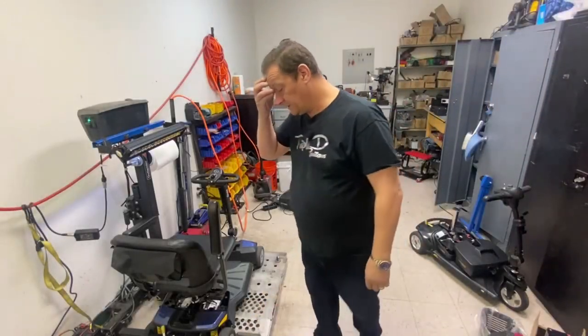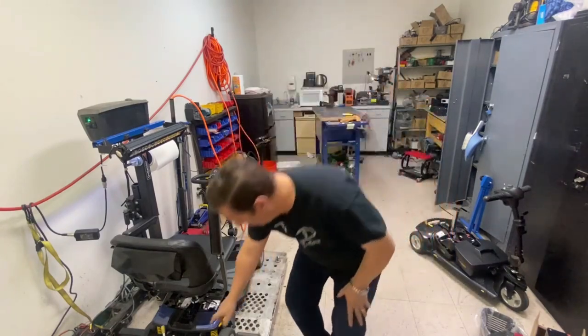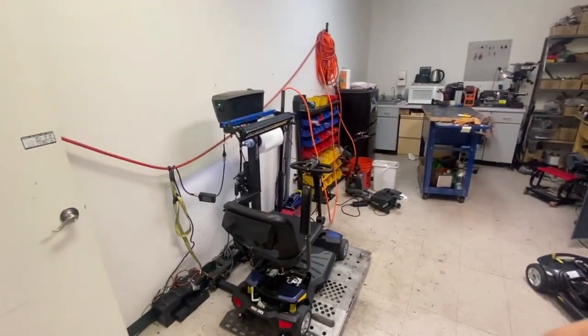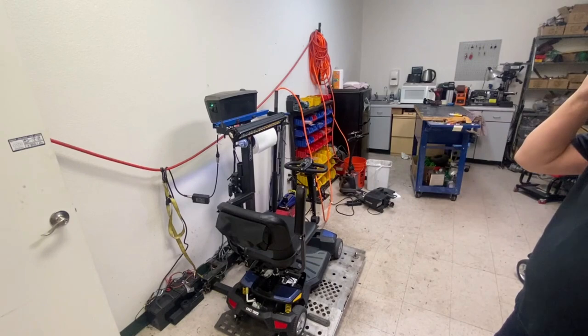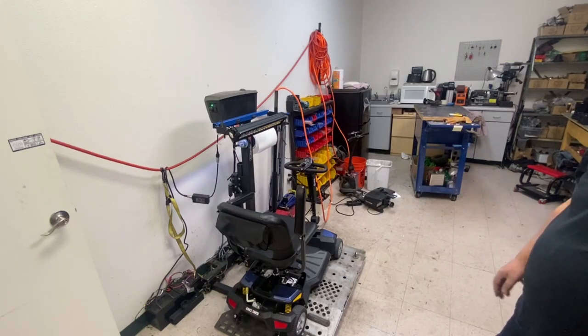Okay, so what I've done is replace the motor, put the wheels back on, everything's back in place apart from the brake, which I've left down there. If you can see, it's on the back of the scooter, hanging out the back there. So I ran it with the brake off. It's not the transaxle, unless the brake is causing the transaxle to do something that I don't know about. But it ran fine. Different speeds, different throttle positions, different cornering.